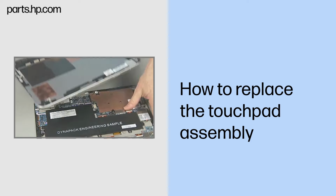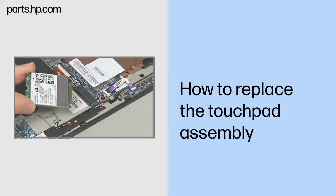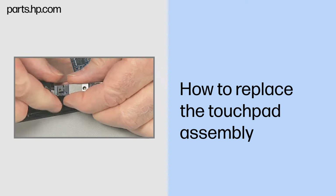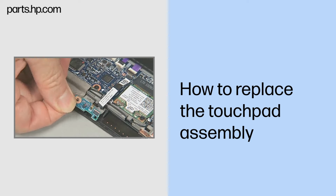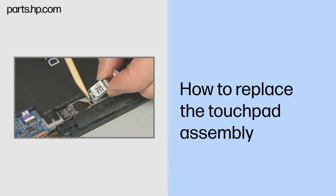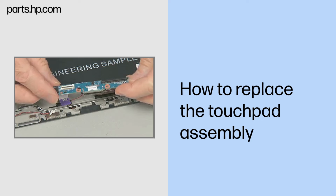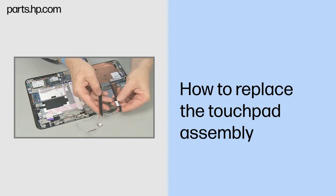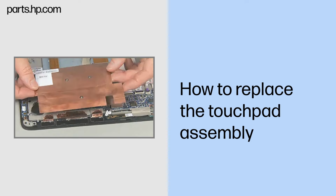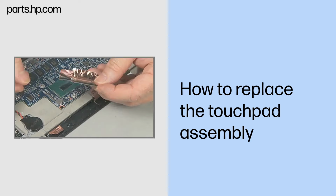Remove the back cover, Slate battery, wireless LAN module, wireless WAN module, mSATA flash cache module, volume board, webcam module, proximity sensor board, power button board, touchscreen control board, NFC board, audio board, vibrator module, docking board, SIM card reader board, speakers, display EDP cable, real-time clock battery, heatsink, system board, wireless LAN antennas, and wireless WAN antennas.